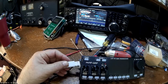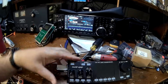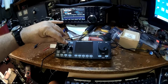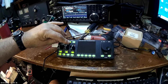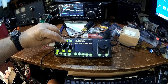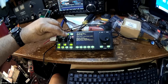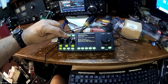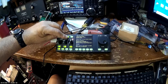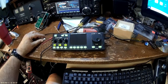Now take your USB drive that you've put the latest firmware on — put the lime in the coconut, shake it all up! Press and hold the band minus button and the power button, and wait. It will detect the USB stick and start updating. The screen will show 'Remove drive or press band minus to reboot, press power to switch off.' We'll reboot it.